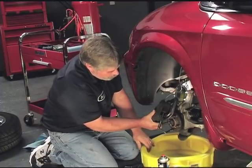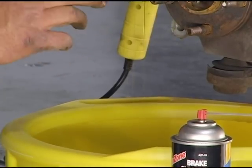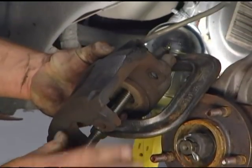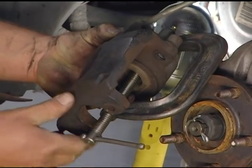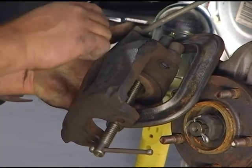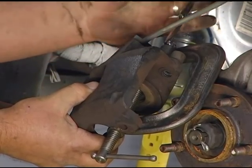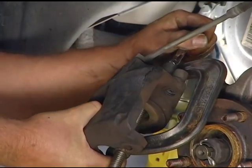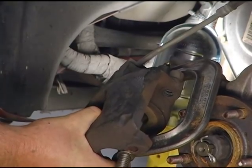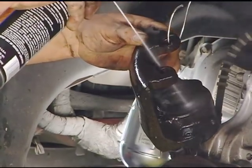With it open, we're already losing fluid — you want to have a pan to capture it in. When we get to the very bottom, you don't want to over-tighten it; just hold it like that and go ahead and tighten your bleeder back up. Check the dust seal on the outside of the caliper and make sure it's not ruptured. If it is, you either need to rebuild the caliper or replace it, because debris will be allowed to get in there and it can make that brake lock up. Take some brake cleaner, spray everything down real well, get it all cleaned up and we'll be ready to put our new parts on.